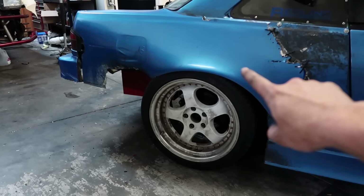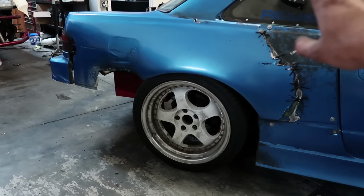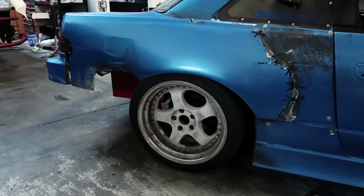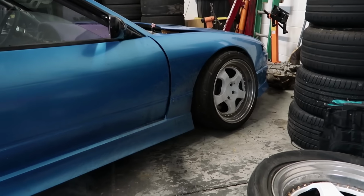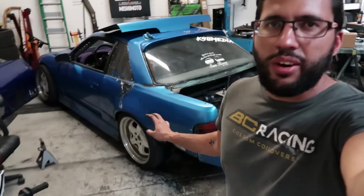I wanted to see the top of the tire, maybe a little bit taller, and then I want the car to compress to the rim. So about 1.5 inches of travel. That's not bad. And then the front is about there, maybe a little lower. I don't want to rub either though. So that's where the back is going to sit at for now.